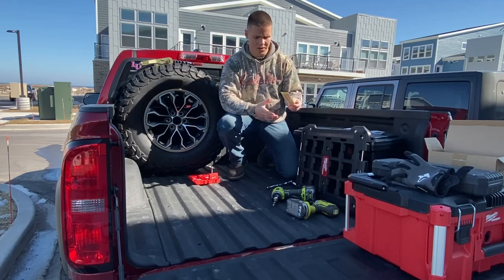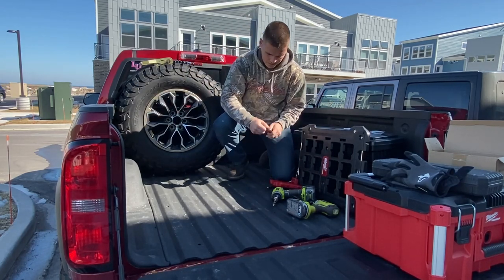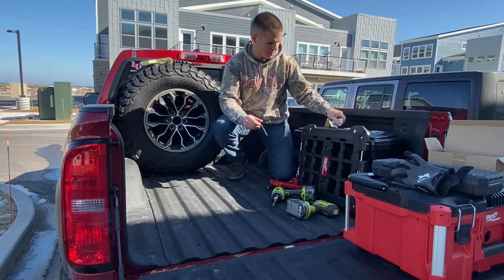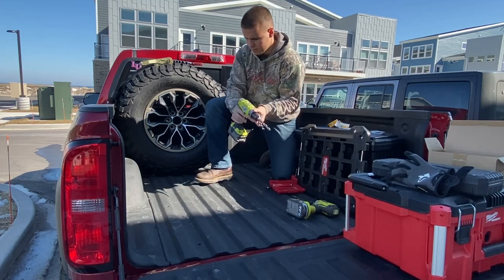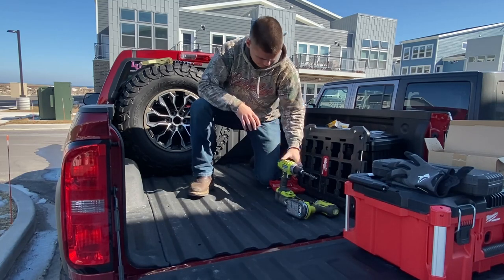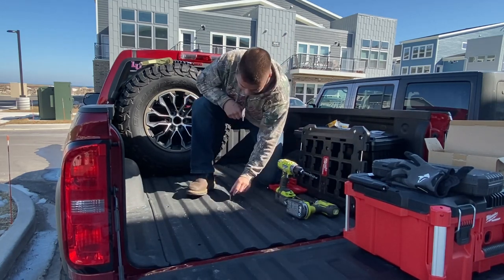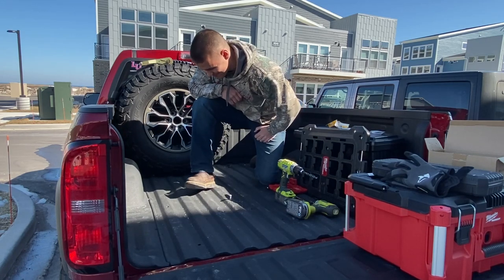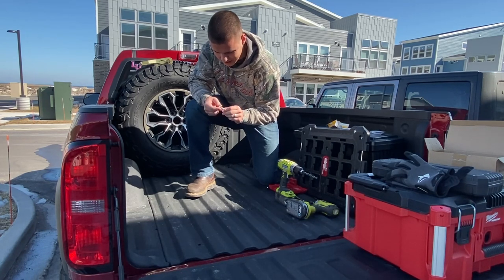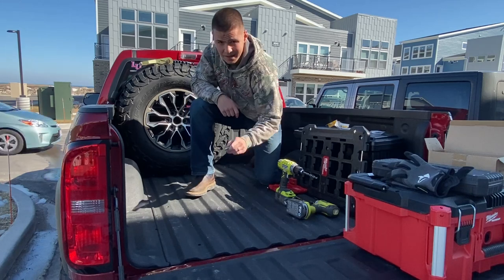So I'm back from the store with the right drill bit, hopefully. See if we can do a little better with this one. Now that is the proper size hole. Learn from my mistake. Metric 8 bolt, the riv nuts that I have for it, 7/16 is the right size hole, not 1/2 inch.